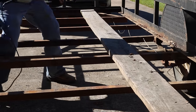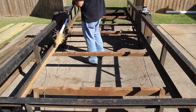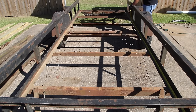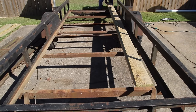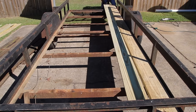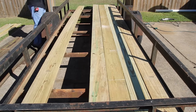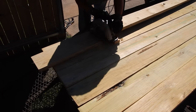I don't use the old bolts when I put all the new wood in — I do something a little bit different and I'll explain that in just a second. I got all the wood out and I'm going to clean up all of the surfaces that the wood will rest on. Then I'm going to measure to make sure I've got the right measurement to go all the way from the front channel that this wood fits into all the way back to where I took that piece of angle iron out. I want to go ahead and get all the boards in here, cut them off, and slide them in place one at a time.